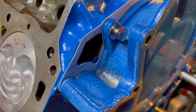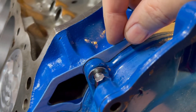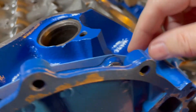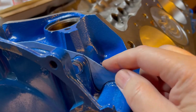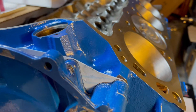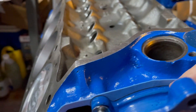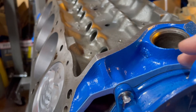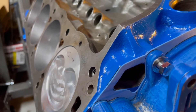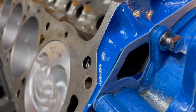I set my timing cover back on with the gasket. I always hated how these front gaskets stick out past the cover — it looks really cheesy, just flapping in the breeze. Once they start getting wet and oily they just curl up and look terrible. So I marked it with a Sharpie so I can trim it. I'm pretty sure it's oversized just to give it some stiffness when you're putting it on, because otherwise it'd be very thin. But I'll just take my time and use some adhesive to put it on there, probably applied to the cover itself and then put it on the block.